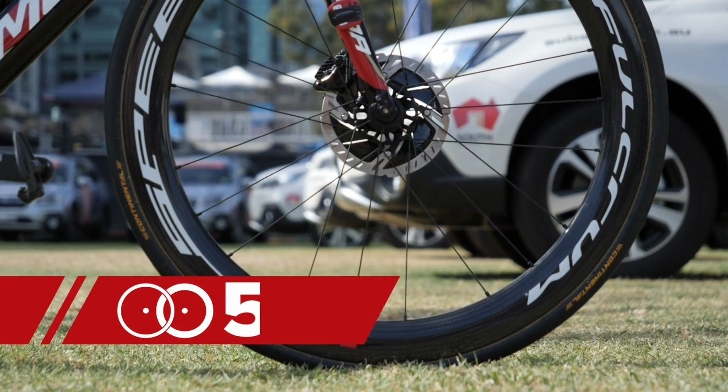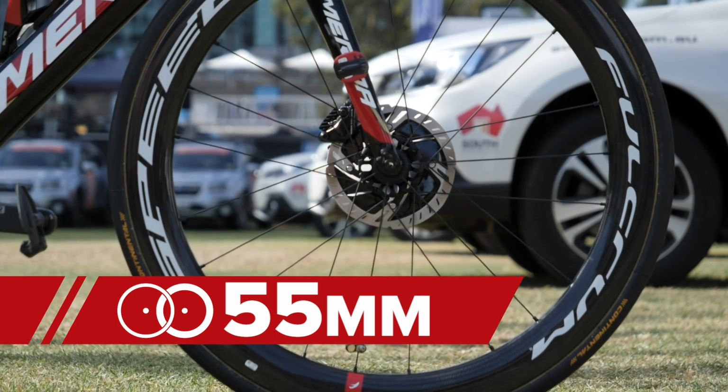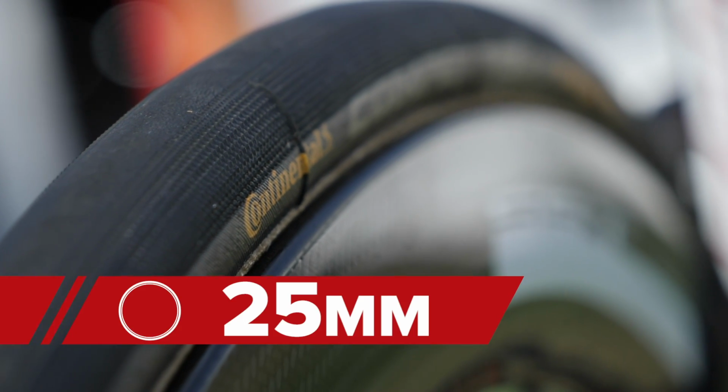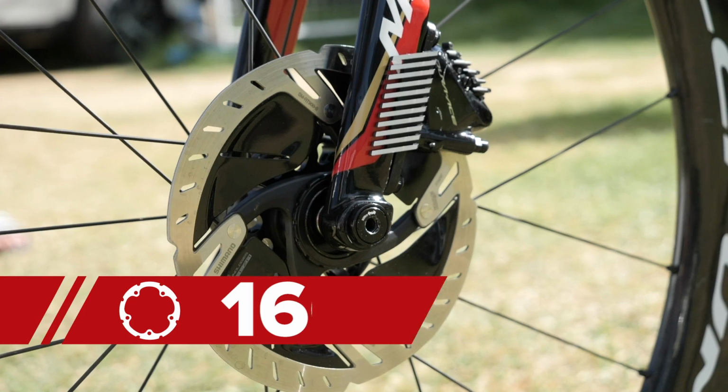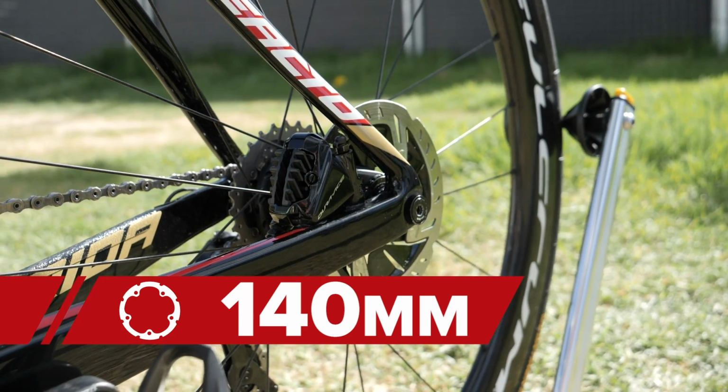Bauhaus rolls on a pair of Fulcrum Racing Speed 55T wheels, which are 55mm deep, and they're wrapped up nicely with a pair of Continental Pro Limited ALX tyres in 25mm width that are just marginally wider than the rim profile of 24.2mm. Fitted onto the hubs are Shimano disc brake rotors. The front is 160mm and the rear 140. That rear hub, well, that's got a Shimano Dura-Ace cassette on there too, with the ratios of 11 to 28.